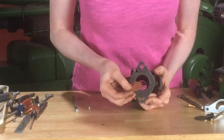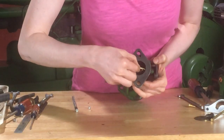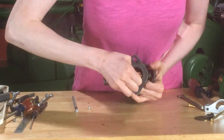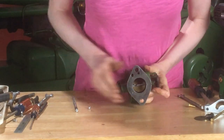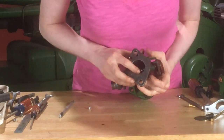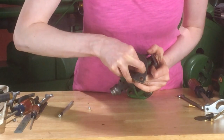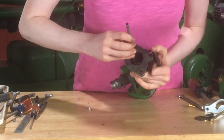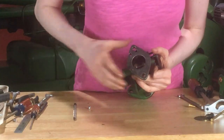I'm ready to put my new throttle door in. You can see that I have my shaft in there the right way because I can see the flat spots. I'll turn it towards the side so that this will drop in and slide that in there. Once you have it about halfway, turn your door back. I'm using a self-starting screwdriver here to line up those holes. Then just use your self-starting screwdriver to drop that down in there and start the screws with the washer behind.